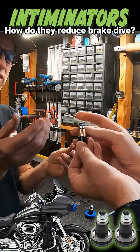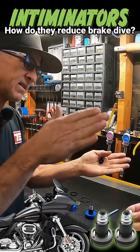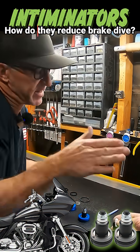And then it returns and closes, so that if you're on your brakes heavy, you're G-ing out, or you're entering or exiting the corner where that bike is compressing down on those wheels, it's forcing it through that shim stack and controlling that compression — not just diving out.